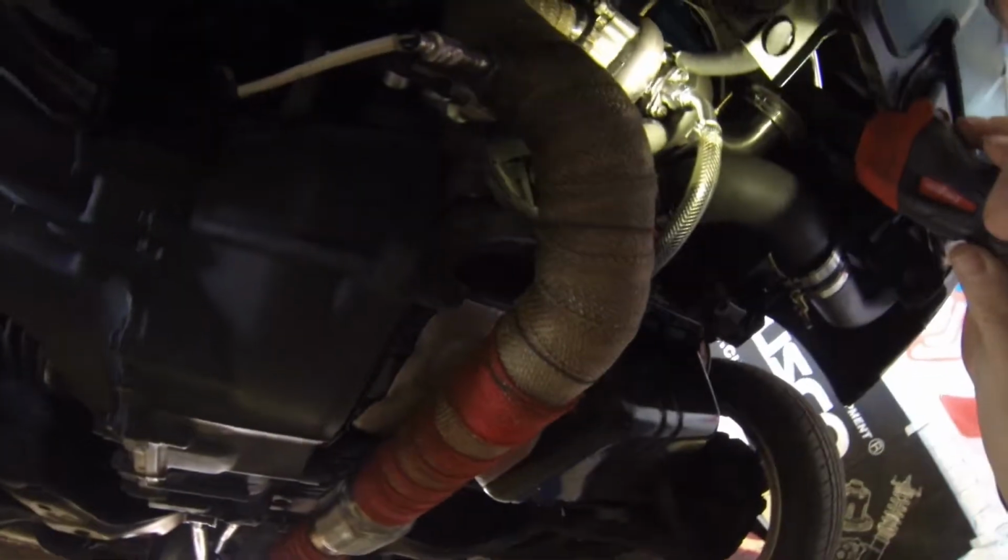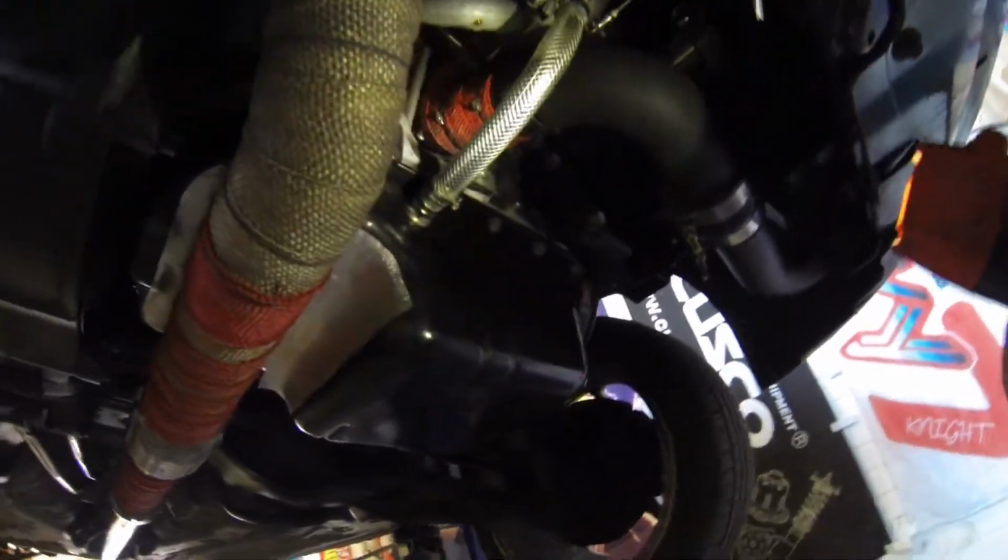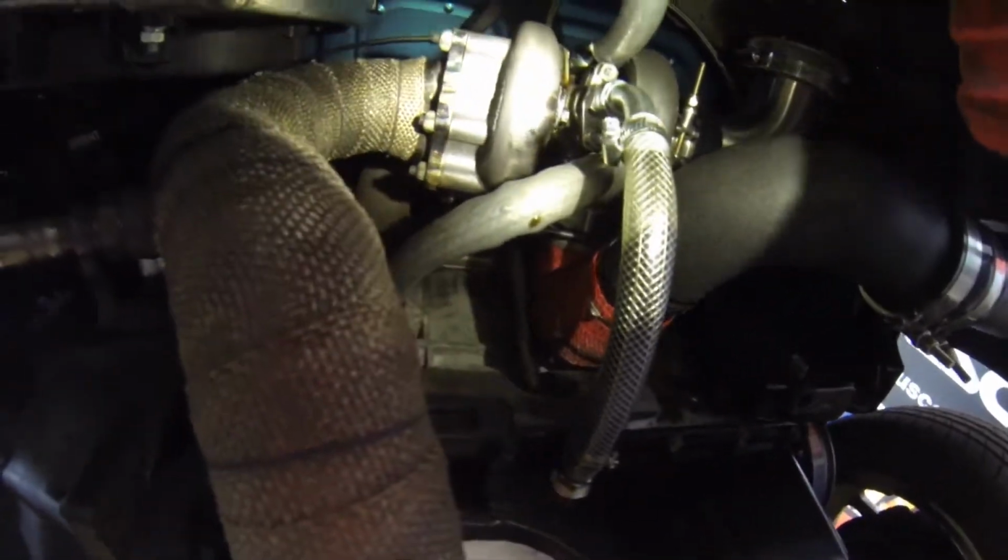The turbo. Well, let's not say the turbo. Smoke coming from the back of the car. Didn't really have it before, and I don't know why. Talking to Liam, Midland Turbo, who built my turbo for me. What I've decided to do, I'm going to change the oil return. After talking to Liam, I'm worried that we've got too much oil going through the turbo.